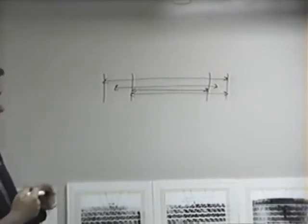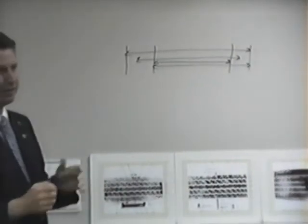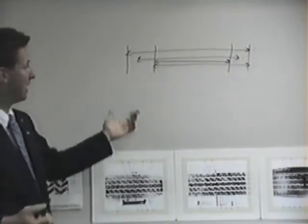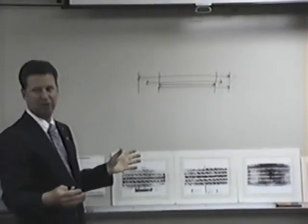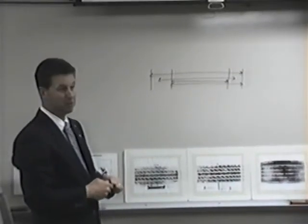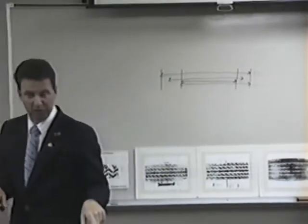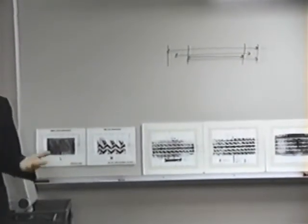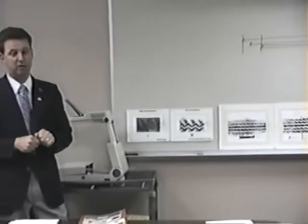But when you have a tire that's wider on one side than the other, if you get an older vehicle that's a clunker, and the guy's got a narrow tire on one side and a wide one on the other, that's going to be a bit of a problem, right? So then you've got to add the two tires together, figure out the average of the two tires, and take half of that. So the simplest thing to do whenever possible is to go center to center, because that is the measurement that the manufacturer has. Rather than do any calculations, you may as well measure exactly what he measures whenever possible.